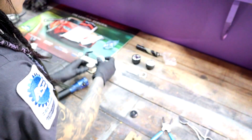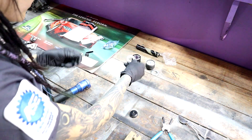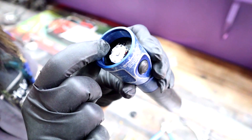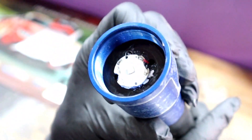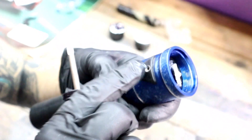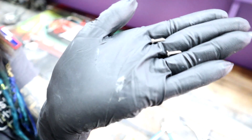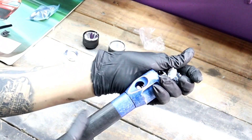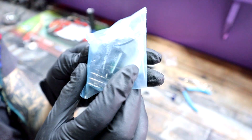There's the old retainer, setting it aside. Here we have the new one from the kit — they look about the same, but I'll use the new one. There's also this little plastic piece, and here's the tiny little LED light. You'd expect it to be more than just that one little guy, but nope, that's it. Next, using a Phillips screwdriver, I'm removing these two screws — these hold the flashlight on the charge port and also hold the internals to the body. There's so much crud in there! The kit also comes with two new screws. I'll reinsert the battery in the bottom and use it to push the guts out.